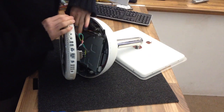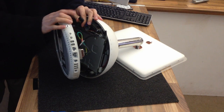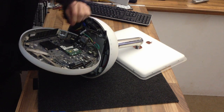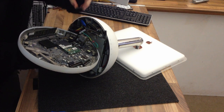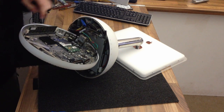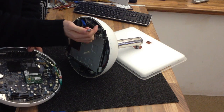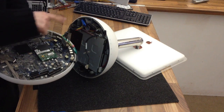What is that? Yeah, that's a pinch and remove job. There we go, that's coming straight off the motherboard. Okay, right. Now this display connector, sometimes these, we've got a little cover that's come off there. Right, this is a sideways one, so it's going to move that direction to disconnect like that. There we go, so it's a little 90 degree connector. Some of them come straight off, some of them go off sideways.